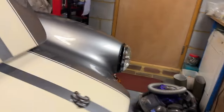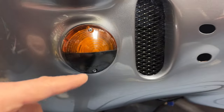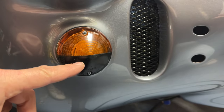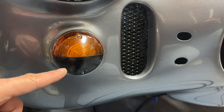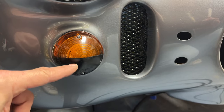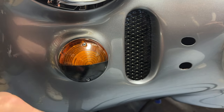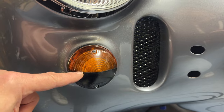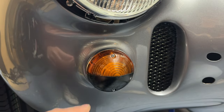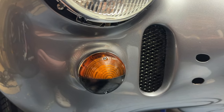Got the IVA-friendly indicators on with the bottom half blacked out. There might still need to be some suspension adjustment - I need to lower it to the floor and check the distance between the black line and the floor to make sure we're above the limits for indicator height. If it's a bit low, all I have to do is wind the suspension around a bit to raise the car up.